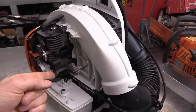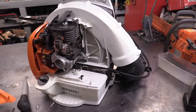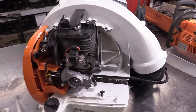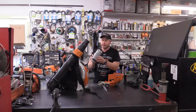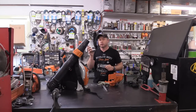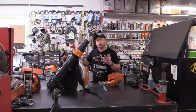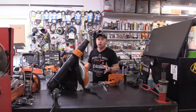Maybe I'll come across another unit like this in the shop and be able to repair it. I'm just going to leave it in one piece in case I come across another one. I have not seen any aftermarket cylinder kits for this machine at all — if you know of any, just comment below the video and I'll check that out. Always make sure you've got the proper oil and fuel mix. If you don't use your machine that much, it might be easier to just buy the Stihl Moto Mix in a can — this is fuel already mixed with the proper oil ratio, and once you open up the can it's good for two years. I hope this video has helped you in your future diagnoses of two-cycle equipment. First thing to check when a machine comes in is pull it over to see how the compression feels, check the fuel, then take the muffler off to see the condition of the piston and rings — that's going to tell you a whole lot about the machine.